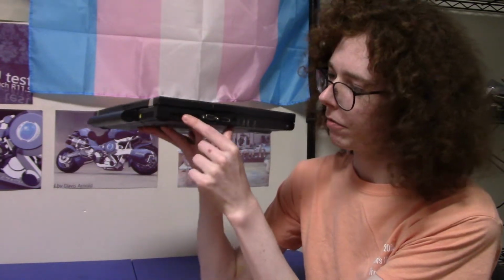It's quite well featured. The left side has one of the fan vents, VGA display port, 10/100 Ethernet if you don't install the right driver, but it is gigabit. You have to manually set it to gigabit in Windows, which is odd for it to actually hit those speeds. 3 USB ports in a vertical orientation, which I will get to later. Express card and PCMCIA slots.